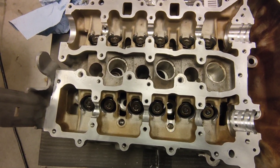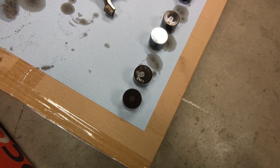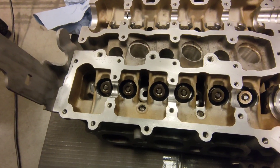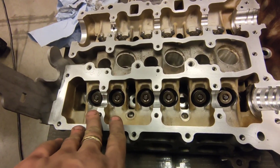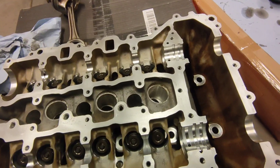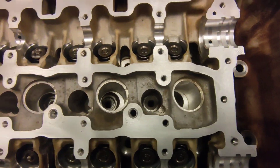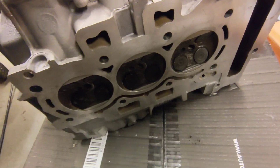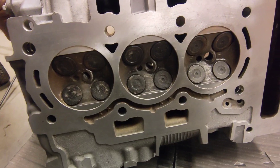So far I've cleaned up the entire cylinder head. Don't forget to take out the washers for the head studs and shims - or lifter shims, yeah, lifters. Once that was done, I've cleaned up the mating surfaces, then degreased everything with brake cleaner, cleaned out the oil passages everywhere, and cleaned out the spark plug holes.